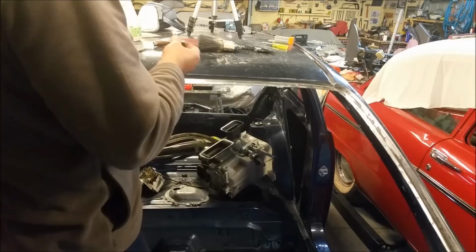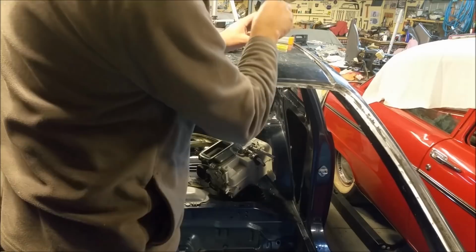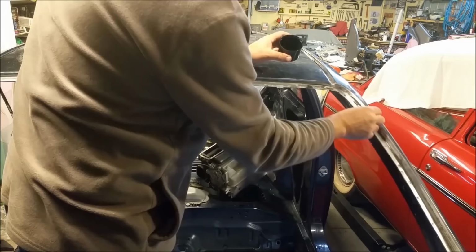Well, no cutting and replacing of metal or welding needs to be done, but it is something that needs to be treated. Just a bit of phosphoric in here on a Q-tip or a cotton bud, whatever you want to call it. I'm just going to go around anywhere where there's obvious bits of surface rust, and it'll probably bubble and make some funny, yeah, see like that. That just means there's a little bit of paint still there. So I've just got around the battery. You can probably see that a bit better.